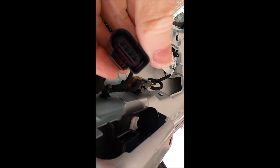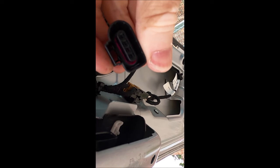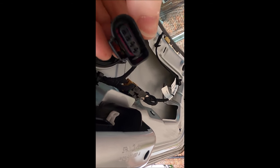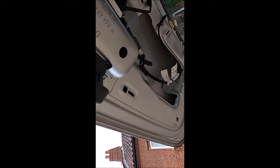The next thing to look at is the boot lock itself — this four-wire plug. All I'm going to do is take that off and then check for voltage. Making sure the car is switched on, just check for voltage at these pins to see whether the lock is receiving voltage. If it's not, you may have a problem in the wiring or perhaps a blown fuse somewhere. I've tested this and I have voltage, so I'm pretty sure the problem is this boot lock.